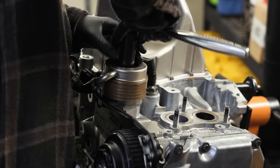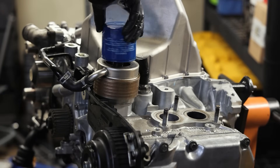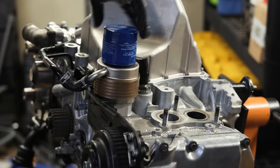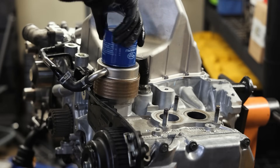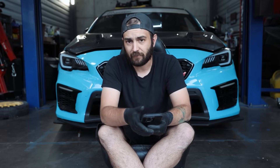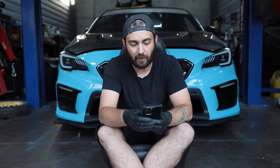You're going to want to replace your oil cooler because that is one of the ones that's damn near impossible to fully clean out. I don't care if you say you've cleaned them in the past — I don't believe you've gotten out every speck of old schmoo out of there. So you're going to want to pick up an OEM thermostat and an OEM water pump. The OEM thermostat is going to open at 185 degrees Fahrenheit. A gasket and seal kit for the 04 to 06 STI list will be down below with the part number.